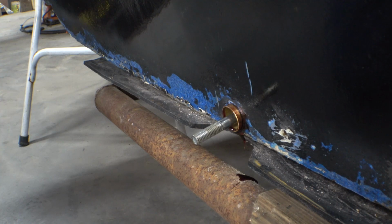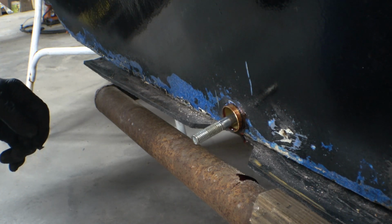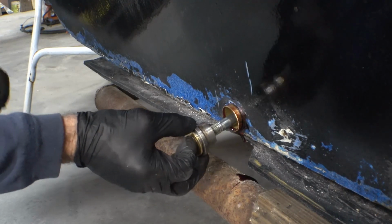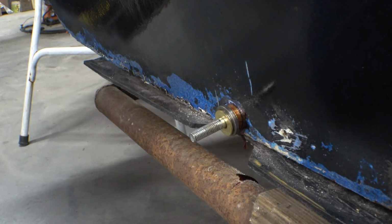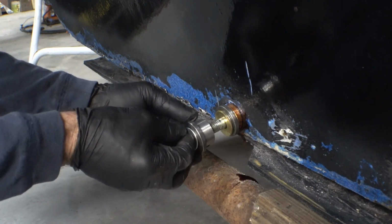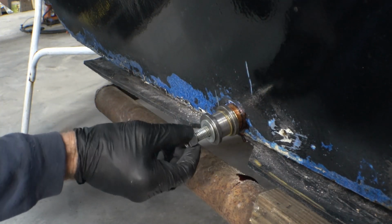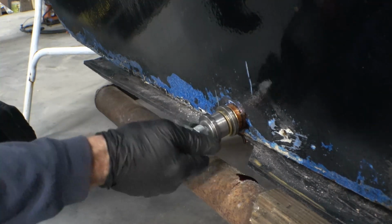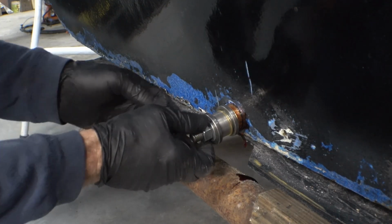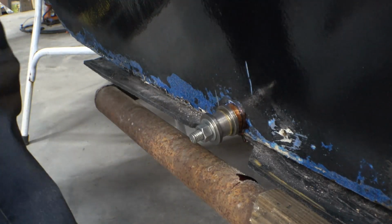And now we come to the outside, and you can see it sticks out about 1/4 of an inch. Because the distance through the hull is so short on my drain plugs, I have to throw a spacer on there. I could have used anything for a spacer, a stack of washers or a large nut. But since I had the custom-made tool holding the inside end of the drain plug tube, I was able to use the inner flaring tool part as my spacer. Make sure my wrench is still on the back side.